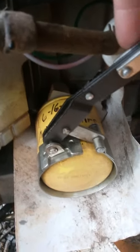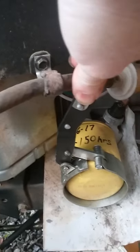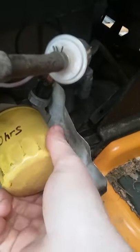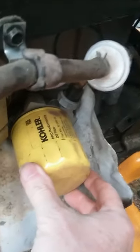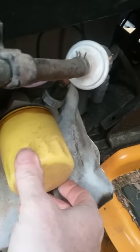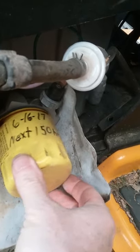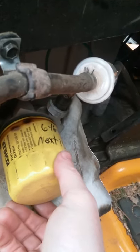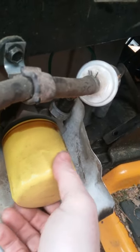Okay, we got it started. It's still hard to do with your left hand when you're not used to it. Let's try getting my finger up against it so it doesn't slip off — there we go, it's loose enough. Sorry about that — we're going to drain this oil out. That's a Kohler filter, but there is also an automotive filter that will fit these mowers. You can buy them at your auto parts store for like five, six, seven bucks, and I've done it in a pinch on a friend's lawnmower.